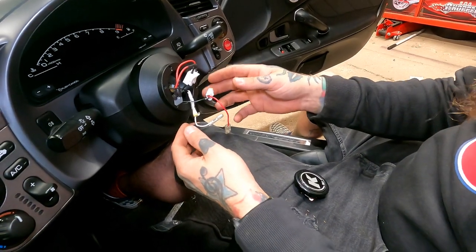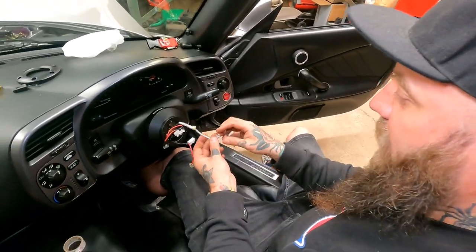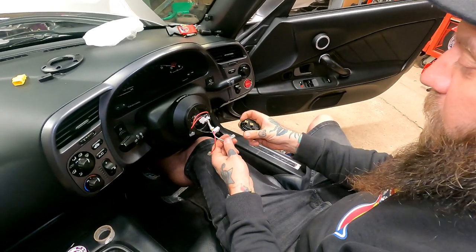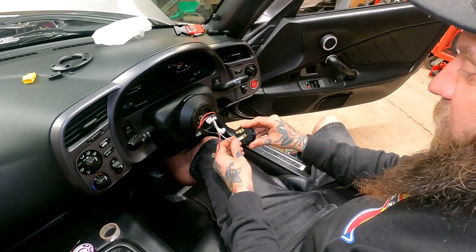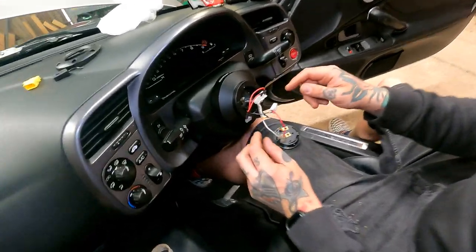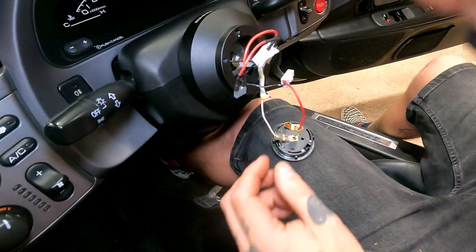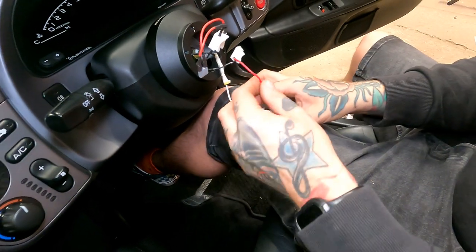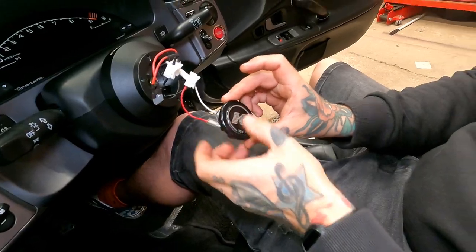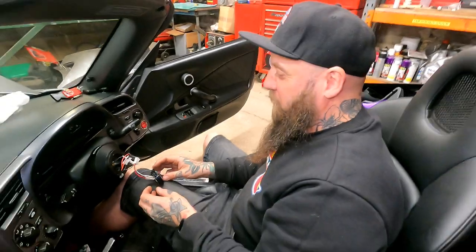So the black cable that's connected to the short hub itself, we added, it comes with two connectors with the boss kit. So we put one of the connectors in the center, like so, and then the black lead that comes from the car itself, which was the ground which had that plug on it, we've chopped off and we've just crimped it and joined it onto the other side of the horn, and she bloody works. So it's really quite straightforward.